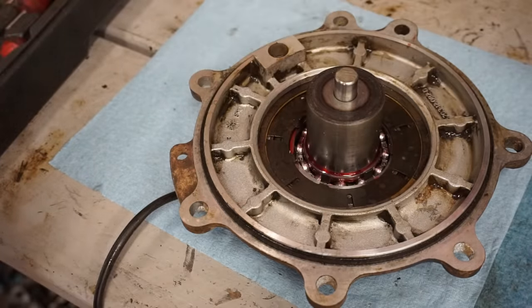And these gears float in here, so once you have oil, it'll sound a lot better. These little pins right here are for the 4x4. These have to line up with the little grooves right here, so it's a little tricky. Let's see if we can do it. Let's just pull this up a little bit here. Like that. Make it a little easier. There we go. All right, perfect. Get your bolts in here.